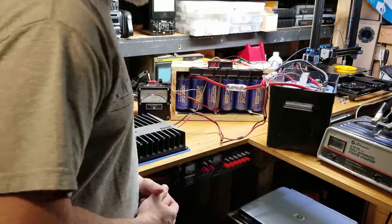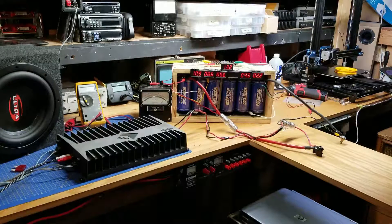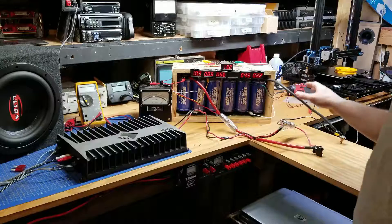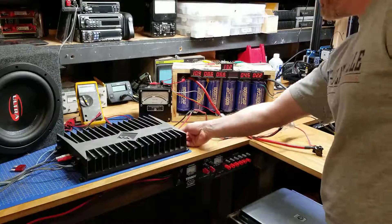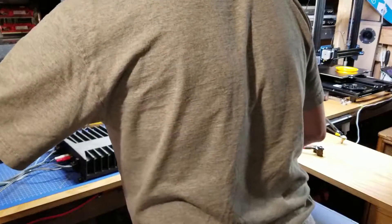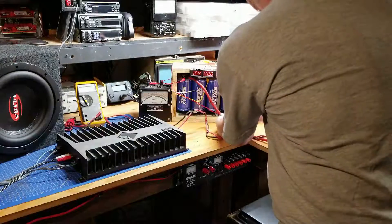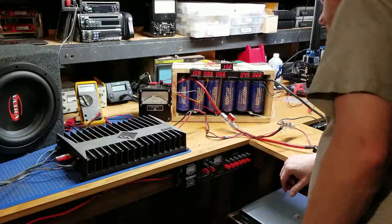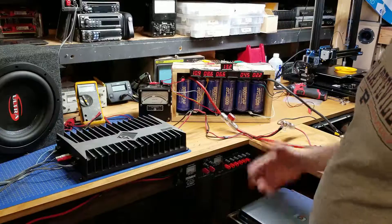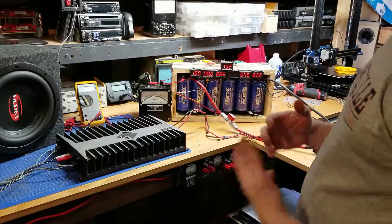Let's set up for that. Now as you can see, the battery is gone — it's actually down here under the table. So what I'm going to try and do is run this amplifier on capacitors alone. As soon as I insert this fuse, we start our countdown. I expect the voltage to drop pretty quickly. We're on — 13.2 volts. Keep in mind that we're at 13.2 volts and we expect that to drop very, very quickly; if not, we'll just do volts over time.